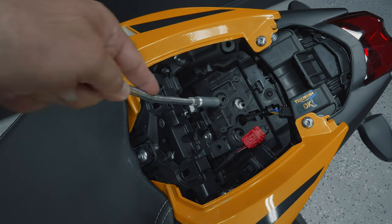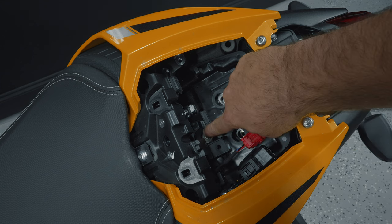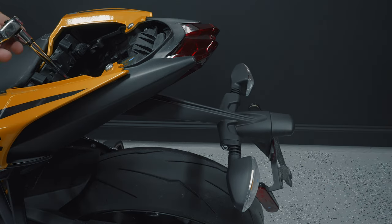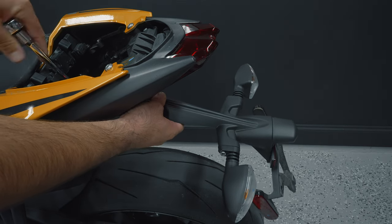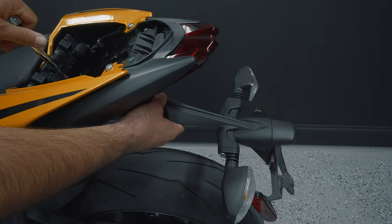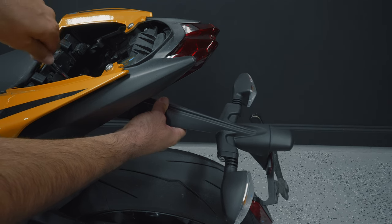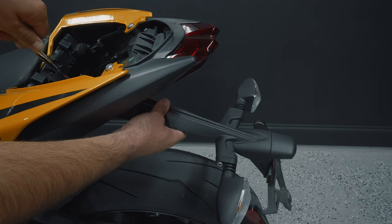Once you've gotten all of them out, I took out three but left the fourth one in place so the tail doesn't hit the ground — that fourth one keeps the tail supported. Now you want to loosen up that fourth bolt, but hold onto the tail so it doesn't fall. You don't want to break the tail or your turn signals because you may want to use them in the future. Loosen that fourth bolt and it'll all start to come apart, but it won't fully separate yet because there is a cable still running to the tail.